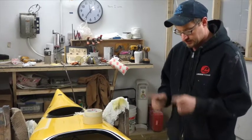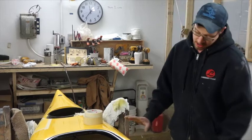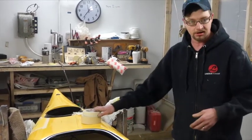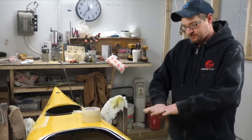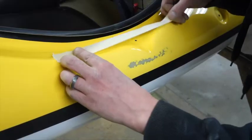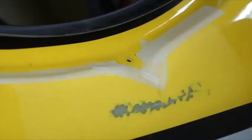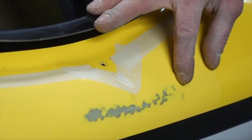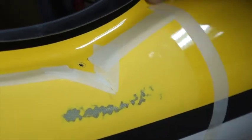The key to repair is if you have a small crack, you want to spray a large area — that helps you feather your edge. It's kind of like doing sheetrock or drywall: the bigger the area, the easier it is to feather it and hide it. The shine into where it's sanded — with this side I'm a little closer than I want to be. I usually go about two inches larger than what it should be, so I'm actually going to move my tape line back here to give myself a little more room when I spray it.